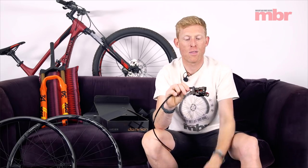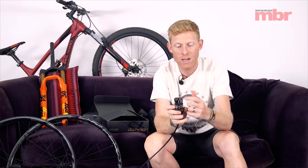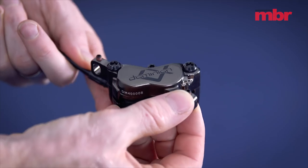Let's go to the other end — the pointy end of the brake itself. This is the new Dominion A4 caliper — it's a four-piston caliper with a pretty big brake pad. One neat feature I think is fantastic is something called CrossHair technology. There are two little grub screws on the side of the mounting holes that allow you to fine-tune the caliper position so you don't get any rub whatsoever. Once set, it shouldn't move no matter how much force goes through it, so as long as the brake pistons move the same amount each side, you shouldn't have any rubbing at all — a really neat solution to that common issue.